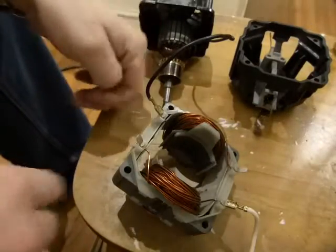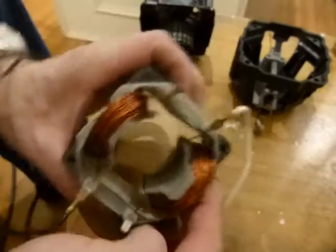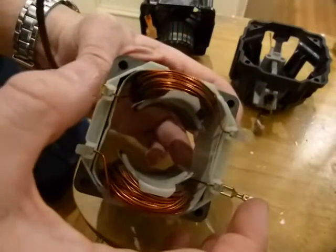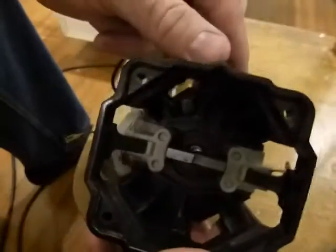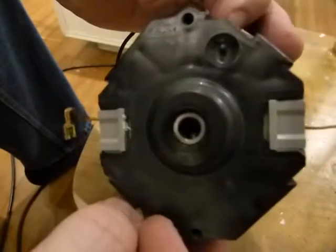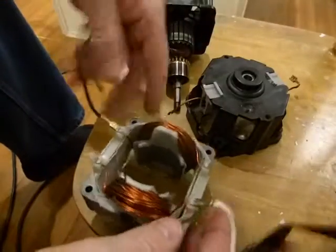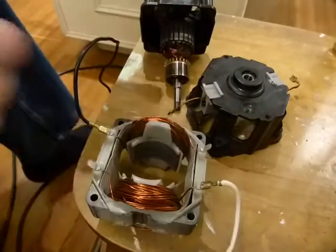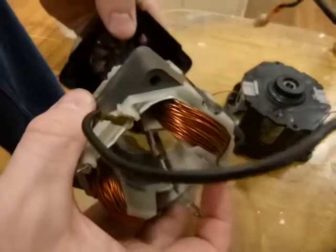Assembly-wise, this part with its four terminals — one, two, three, four — are completely reversible. So it doesn't matter where you attach the black and white wires, as long as they are diagonally opposing each other. Either this way or this way and you'll be fine. This part as well — it's symmetrical, so it doesn't matter which way it's hooked up, as long as the two brushes are diagonally opposing each other. So if the black and white wires are here, then the brushes need to be hooked up here and here. Likewise, if the black and white wires are here, then the brushes need to be hooked up there.